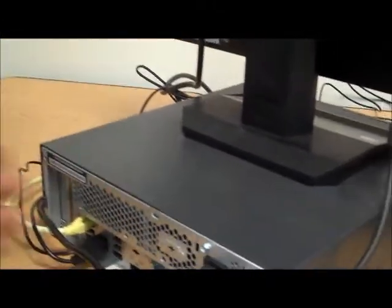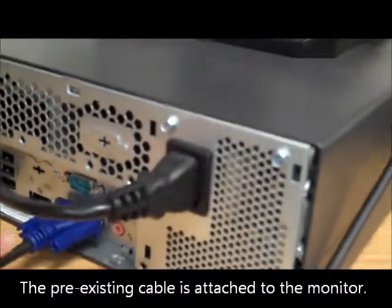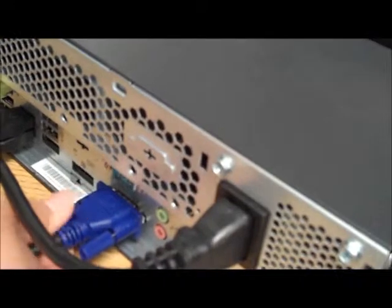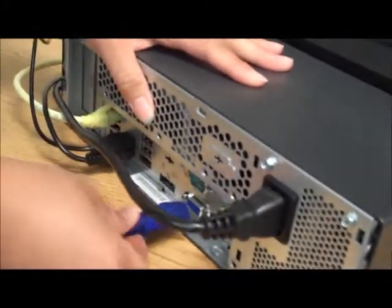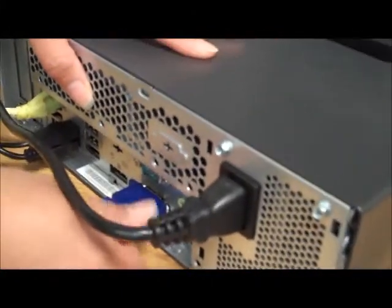When you attach the RGB cable that went from the projector, find the back of the CPU. There will already be an attached blue RGB cable. What you need to do is detach this one — unscrew the pins and make sure the pins are screwed off all the way so you don't pull off any of the pins. Then take the RGB cable that led from the projector and plug it into the back of the CPU. Screw in the pins to make a nice tight connection.